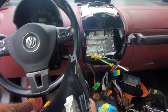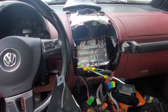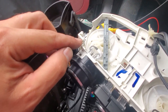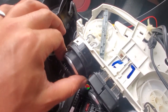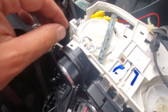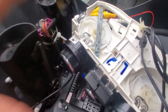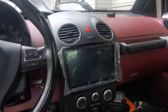Here's the huge mess that's going on. This little bracket on this side where your blend door and everything is was hitting this — you can see it's close. So I had to break this tab off, now it spins. Now put it all back together again and see if it works.